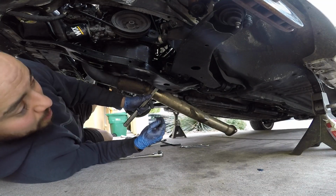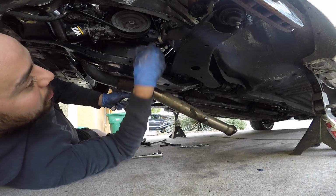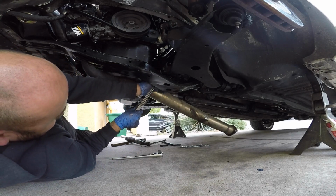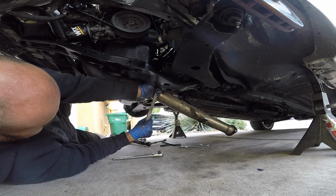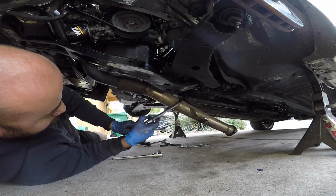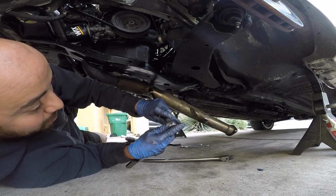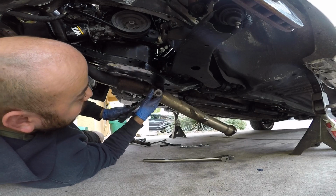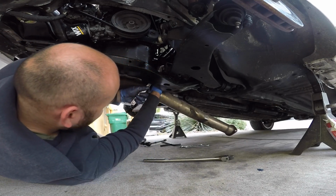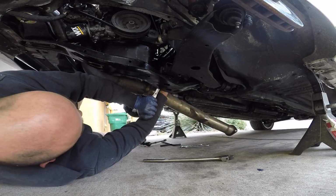Okay, you guys probably can't see a whole lot, but you can get to the 17 either up here or right below, and I got it, and it is broken loose. You use the breaker bar, a pretty long extension. Now it's loose. There's still one more bolt up there that I have to somehow get. But I've done this before, so I know it can get done.